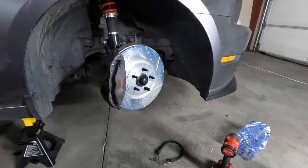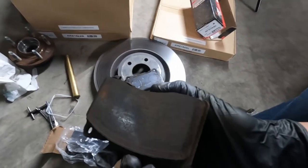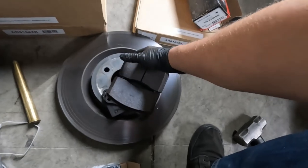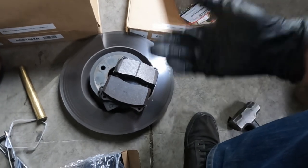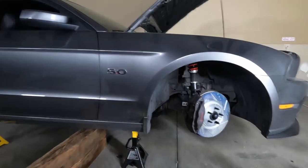So I got this side all put together. I got three more sides to do. But I kind of wanted to look at these brake pads — honestly, they're still fairly new. Visually I can't really see what the difference is. I know it's a different compound, so this one probably grabs a little bit better. Once I get it all together, I'll go for a drive and see how much better these things brake. What I should have done is take this thing for a drive first — there's actually a brake performance test in the computer. I tried to do the test but I couldn't find any place that was flat. It's either 60 to 0 or 100 to 0, and most of the places where I could slam on the brakes, I can't find a flat area around here.